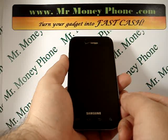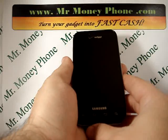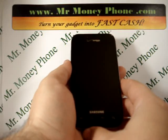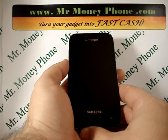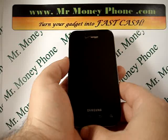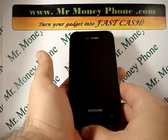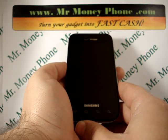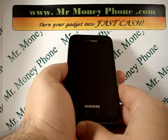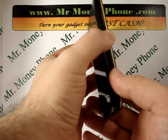While this is powering off, I'll let you know: doing this hard reset will remove any information on your phone. It'll delete any contacts, phone numbers, email addresses, any photos or videos. So before you do this hard reset, if there's any important information, make sure you back it up first — either back it up to your computer or to another phone — but if you don't, you will permanently lose that information.